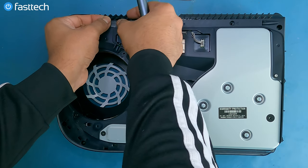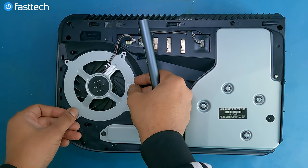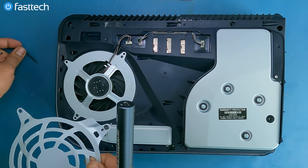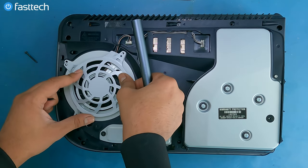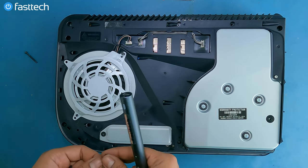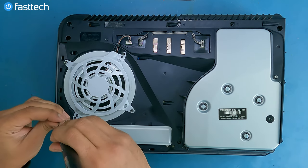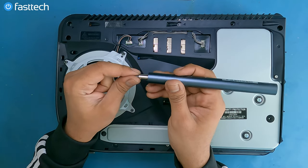Let's reinstall the factory warranty sticker on the system. Now let's install the fan — it goes on like this, just reconnect the connector. Now this is very important: the cover goes on like this. These two screws go here and here. The very tall screw goes in here, and then the shortest one goes in here. If you screw this up, the only bad thing that happens is you destroy your motherboard.